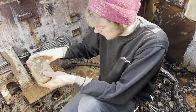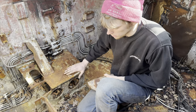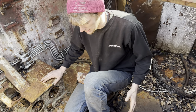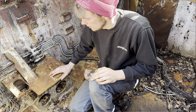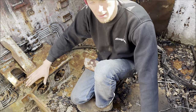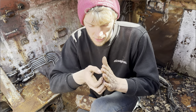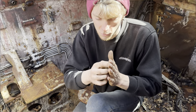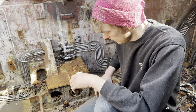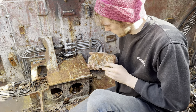That's a major problem, because the engine and gearbox are shimmed up separately - they're not a pack. Everyone calls them an L60 pack but it's not; it's an engine and a separate gearbox. The engine needs to sit dead in line with the gearbox, otherwise the clutch spinning on the back of the flywheel will be out of balance and it'll smash the gearbox bearings or the back of the crank. That's a major, major problem.